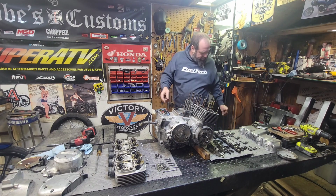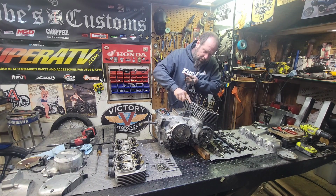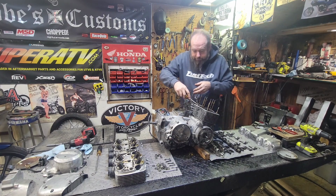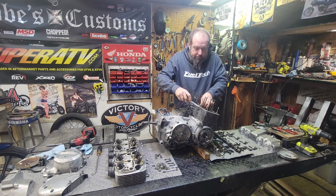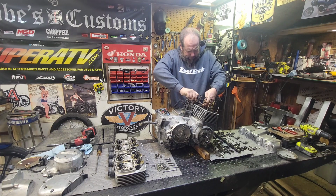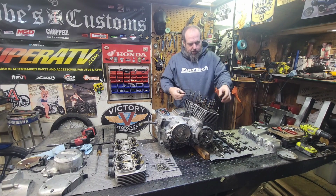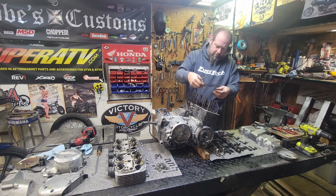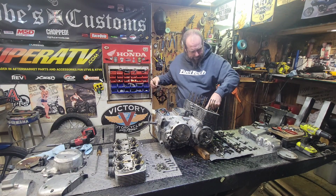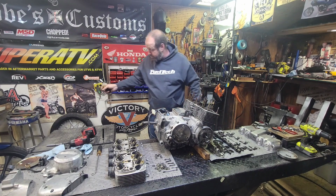It's not looking too bad, just looking old and torn. Oh yeah, there's our crusty cylinder. Definitely got some junk in there. There it goes. Alright, old head gasket's coming loose now. I'm gonna get in there and pry it off nice and slow so you don't mess up the surface underneath it. Got to keep that aluminum nice and happy. These sleeves are looking really good too. Just a little bit of rust on the very top of that one sleeve, but not too bad. Way better than some I've seen in the past that have been sitting, obviously.